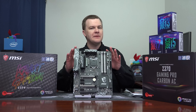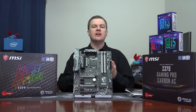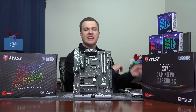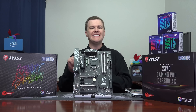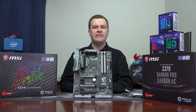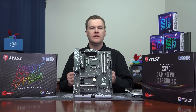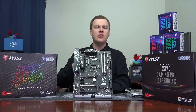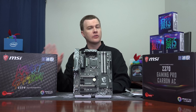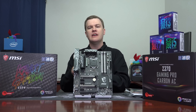So which board should you buy? So far I've only talked about MSI. I will have an upcoming video that's a full 'which Z370 should you buy' review of all the different brands — ASRock, Gigabyte, MSI, ASUS. On my test bench I've had a bunch of different boards: the ASRock Killer SLI, the ASRock Taichi, the Gigabyte Gaming Ultra, the Gigabyte Gaming 7, the ASUS ROG Strix Z370-E, and this board. Every one of those boards hit 5 gigahertz on the i7-8700K at 1.35 volts. I'm finding it's extremely easy to overclock versus the Kaby Lake chips. If you go with the SLI Plus, the Tomahawk, or any lower boards from other companies, you may have trouble getting that kind of overclock because the voltage regulators and power phases are lower. But once you get up to this level of board, that's generally not the distinction.